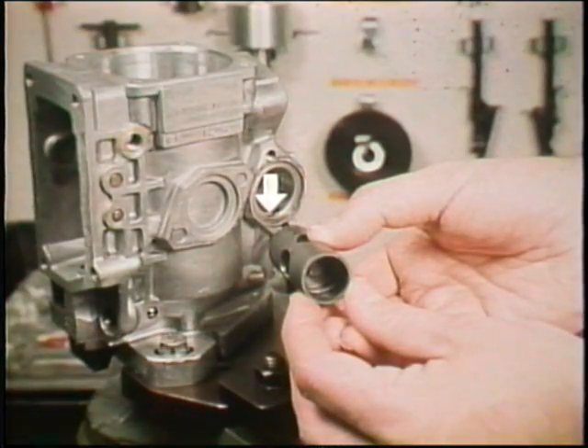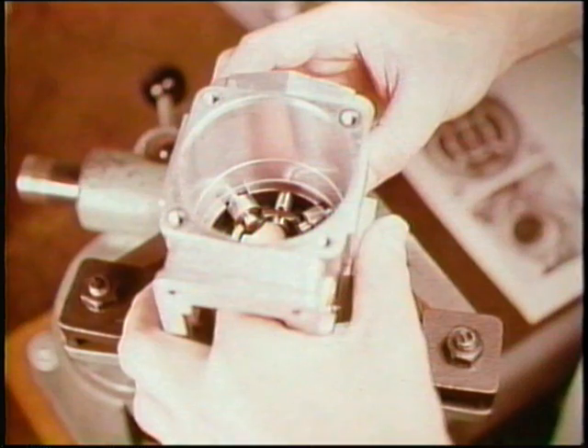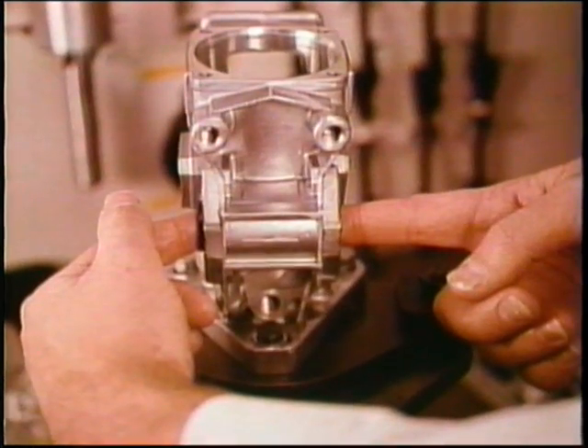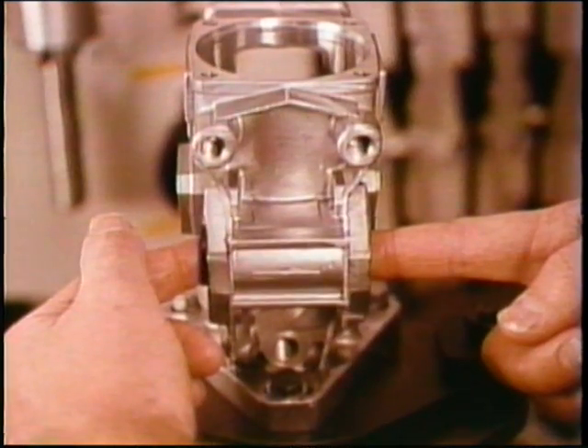With the slider greased, insert it into the timing piston. Grease the timing piston and hold it so you can see the fuel passage and the piston's hollow end. Now rotate the slider so you can see the hole. Wiggle the timing piston until you can push the connecting pin into the slider. Secure it with a retaining pin and install the clip. Slide the timing piston back and forth to check the freedom of movement — you should feel no drag as the piston and roller cage move together.